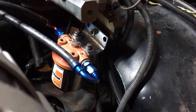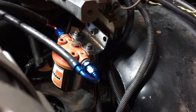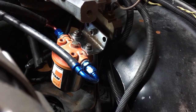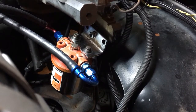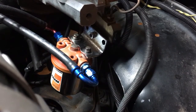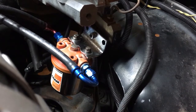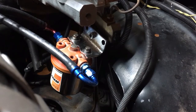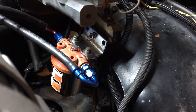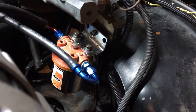Basically what I found was that that Fram canister-style fuel filter would work perfectly to send a vacuum signal from my intake manifold to the PCV valve, and let any oil that's sucked up drop into the reservoir of the filter. It has no filter element inside — I want to make sure everybody's clear on that. I did not put the actual filter element inside of there.